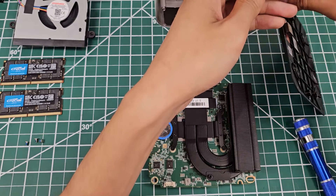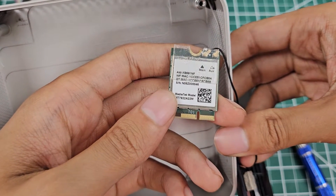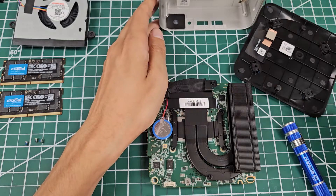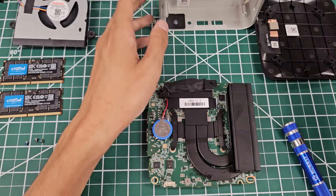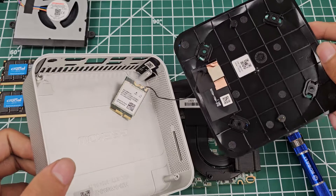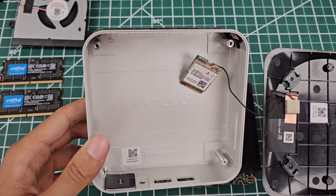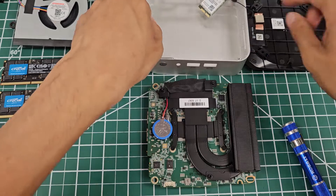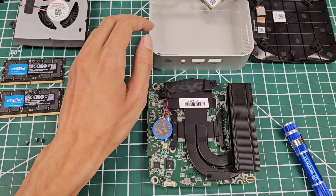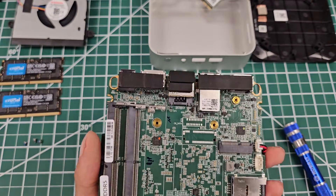The wireless card is a very unique card — model number AWXB691NF. I ran some Wi-Fi tests and didn't have issues with it. It does have relatively small antenna pads — one is tiny and stuck inside the corner, the other is on the top plastic case. I would have liked to see larger antenna pads or even antenna ears for longer wireless range, but it works.